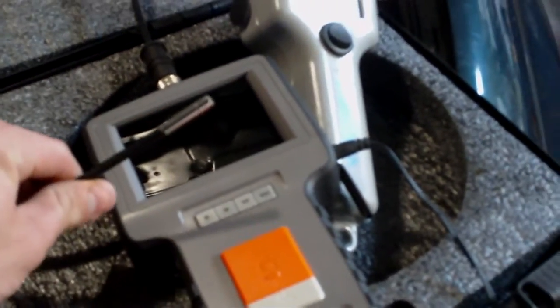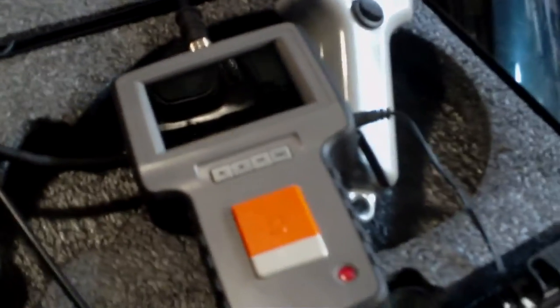I'm going to record a video with this endoscope so you guys can get a better idea of what I'm talking about. As you look up at the top of the V on the turbine, you can see right there it's a little bit of oil starting to run down — see how it's a little shiny and moist. That's basically caused by the piston ring in the turbine not sealing properly, causing it to leak down in there a little bit.